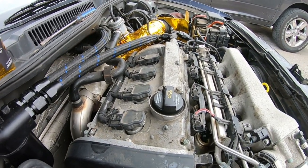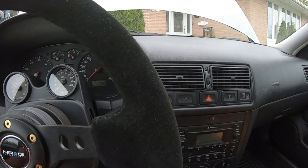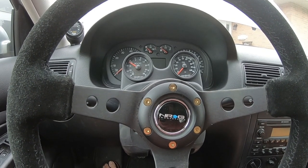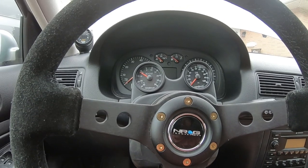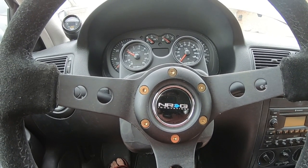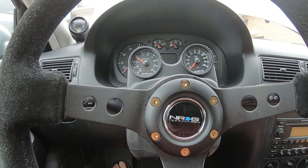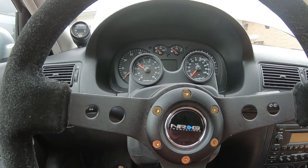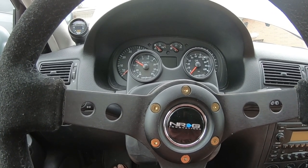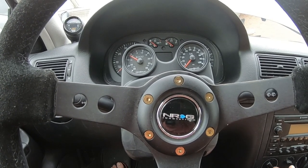We're sitting in the car now. We've got the fuel pump installed and the new injectors installed, so we're going to prime up that pump — battery is already hooked up, so I'll cycle the ignition a couple of times to build fuel pressure to the brand new injectors. Also, highly recommend you do not go driving around to show off the new injectors and fuel pump — your car is going to run very rich, and your ECU won't know what to do with the new injectors, or it will try to compensate in other places.